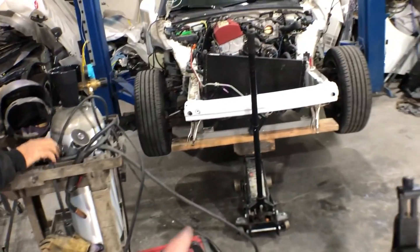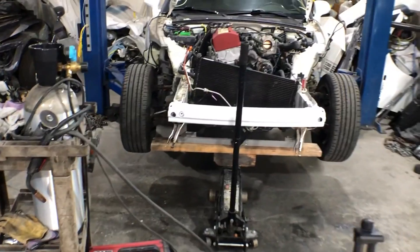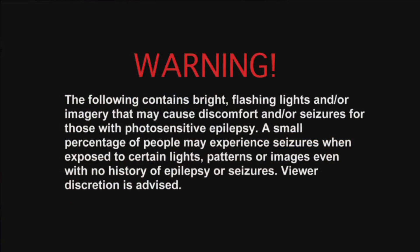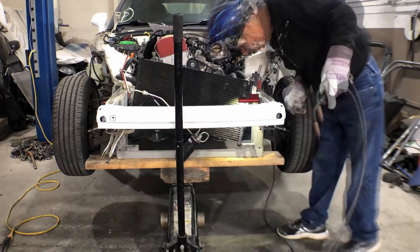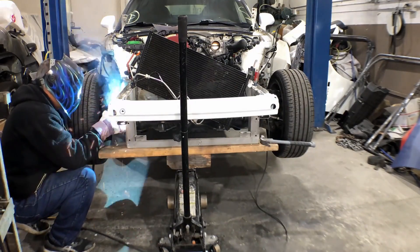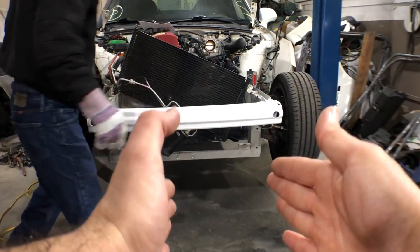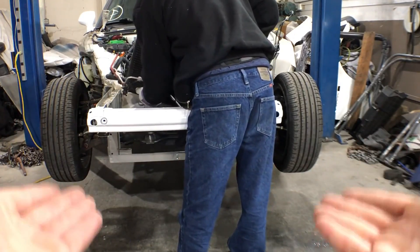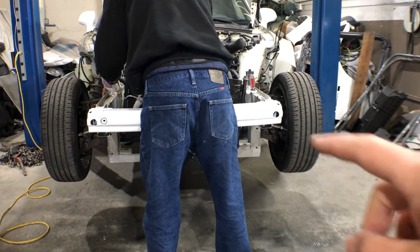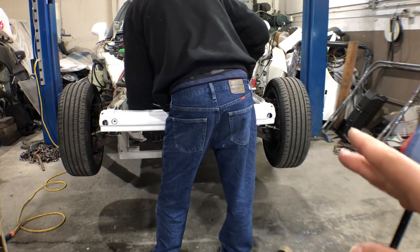Alright guys, so got the lower portion clamped on, all cleaned up and ready for the weld. It's time to get the lower portion welded up so then we can do the upper portion. The lower piece all welded up on the sides and inner sides of the frame rail. Now we're going to have to lift the car up because there are spots on the bottom side too. Once that's all welded up, we'll do the top, then go through all the spot locations with the grinder and then seal it.